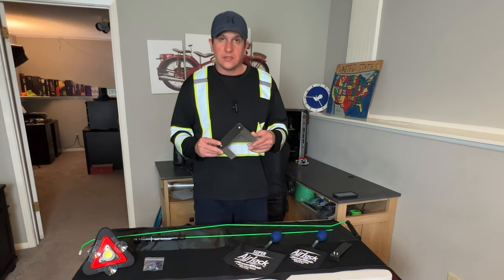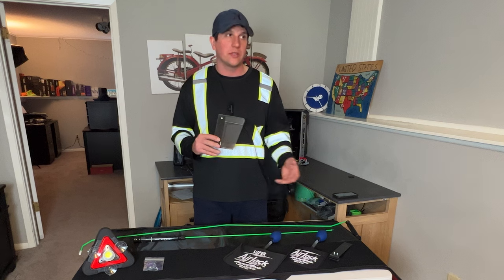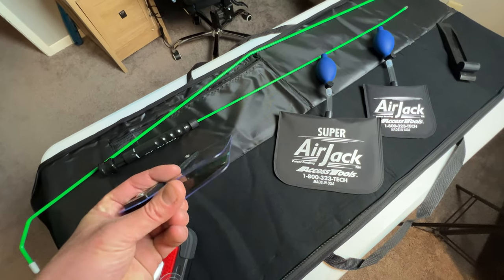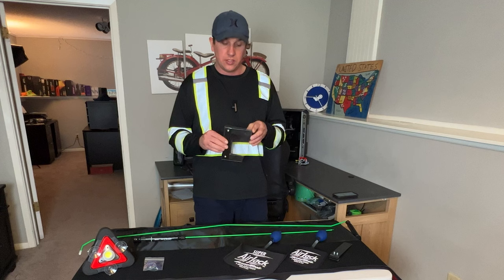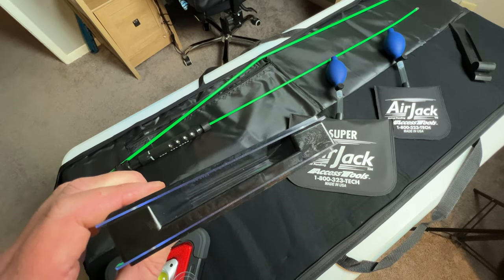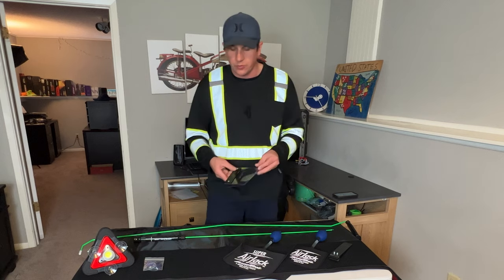The Glassman is used for frameless windows. I have been known to use the air wedges on frameless windows, but I do get worried about breaking the window or causing more damage. This is probably your safest route. It comes with two polycarbonate sheets surrounding a dual wedge on each side. You stick it into the window and there's a gap on the rear side where you would insert your 52-inch Quick Max or your 36-inch Button Master to get the vehicle unlocked. Using this also makes you look a lot more professional.